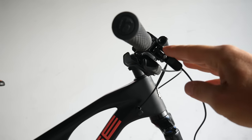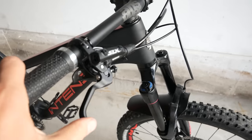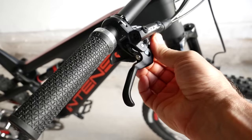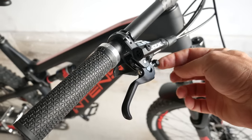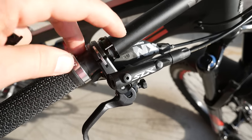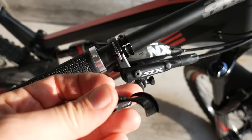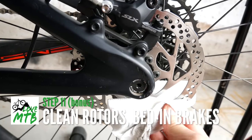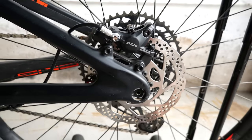If you're unsure about adjusting the angle of the lever, just put it about 45 degrees to the ground as a starting point. Also, the reach should be adjusted properly — it should be right at your knuckle in a normal lever position. If you don't have a knob, you're probably going to have an Allen key to make that adjustment. If you have the ability, I always recommend integrating your shifter with your brake lever because it looks a lot nicer — in this case I have an ISPEC 2 adapter to SRAM shifter. One more thing before you hit the slopes: clean your disc with a bit of alcohol, and remember to bed in these brakes. SRAM has a very good video on how to do that — I'll post it in the description.